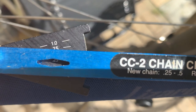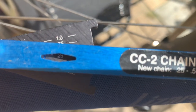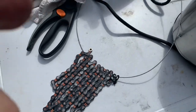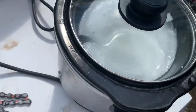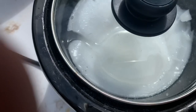That's under 0.25%, so that's still a new chain after 200 miles — there's zero stretch on this chain, I'm quite impressed so far. There we go, that's the chain on a piece of wire, ready to go into the wax. The wax isn't melted yet, so while that's happening I'll wash my bike down — won't take five minutes.